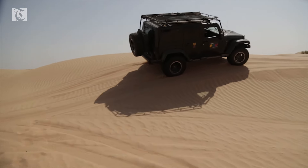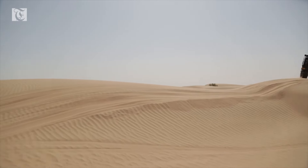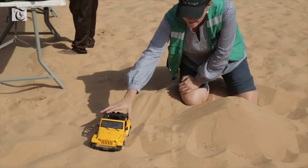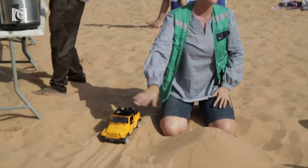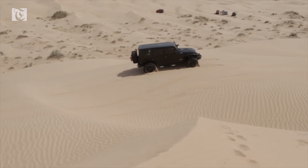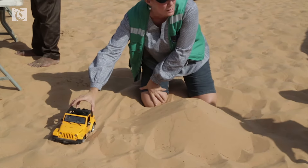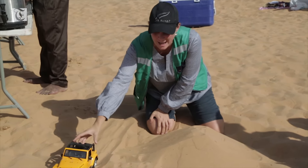You'll find two different sets of tracks this weekend. One where you can see the tread of the tyres of the vehicle that went through before you, and the other where you can't see anything other than evidence that a vehicle has gone through. Clearly this is the soft sand, so perhaps not the best place to stop. But if you do, maybe you need to rock back and forward to firm the sand so that you can carry on.